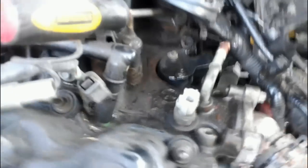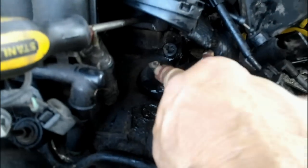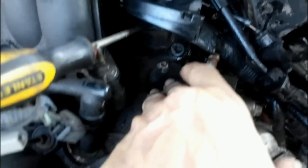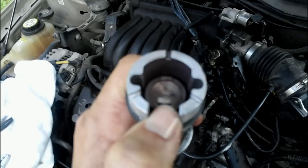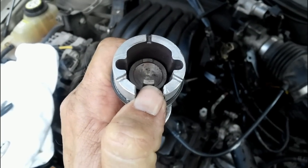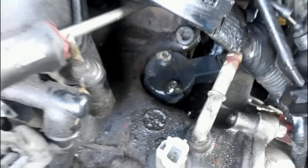I've got to unhook the wire right there. Once I unhook the wire on the back of that, then I can go ahead and unscrew this. When you unscrew this, the first thing you've got to do — I'll show you here in a second once I take this off — you've got to mark that piece that's on top of the cam right here. You've got to mark it exactly where it's at, because if you put the other one in and it's not in the right position, your car won't run.